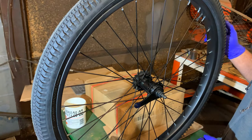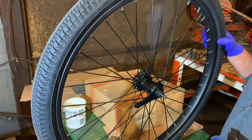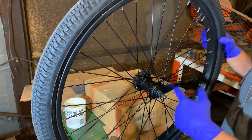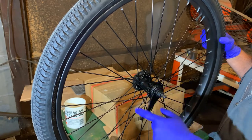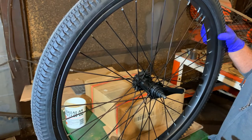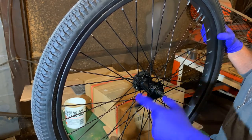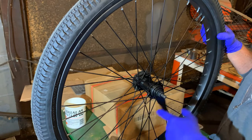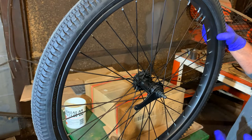What we're going to discuss today: when you're building a new bike, you can't count on the factory giving you an adequate amount of grease on your wheel bearings. When you turn it into a motorized bike, the wheel bearings are going to be working a little harder, so it's important that we have an adequate amount of lubrication so they don't prematurely wear out and you're always having to buy new wheels. It's always a great practice to keep your wheel bearings lubed. When building one new, it is 100% a good idea to check and make sure they are adequately lubed so you don't have any problems.